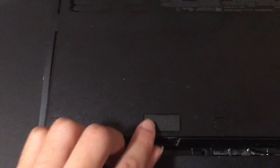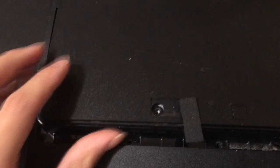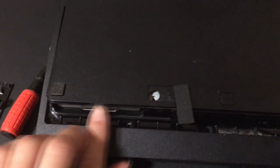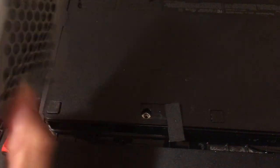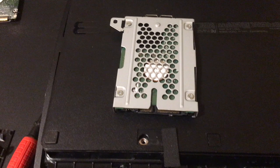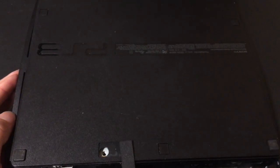Assuming you have all the tools, if you're using a PlayStation 3 slim like I am, go ahead and flip over your PS3 and pop this compartment out right here. Within the compartment there will be a blue screw — take your Phillips screwdriver and twist it out. There's a little compartment on the side of your PS3 that just slides out, so you slide and pull. You should have a little tab — just tug on it a little bit and that's where your hard drive is located. As shown here, this is my 320 gigabyte old hard drive, and there are four screws at the bottom that you need to unscrew.